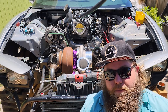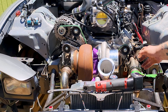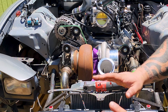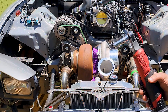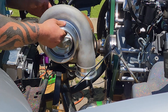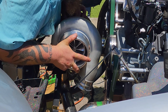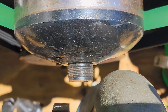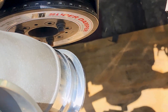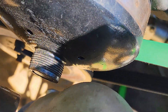Now that we got that important thing out of the way, we need to handle the last important thing before we can start to have some fun. We need to take our compressor side housing off and clock it the way that we're going to have it — in the orientation that is going to follow the intercooler piping to the intercooler — just to make sure no moving parts rub or touch it. This side is clear all the way around, so now we're going to do the compressor side. She's going to be close to stuff but she ain't touching, and that's what I wanted to know. Now that all the critical stuff is out of the way, let's start the party.